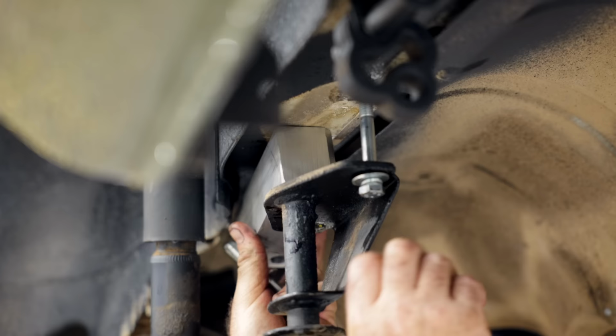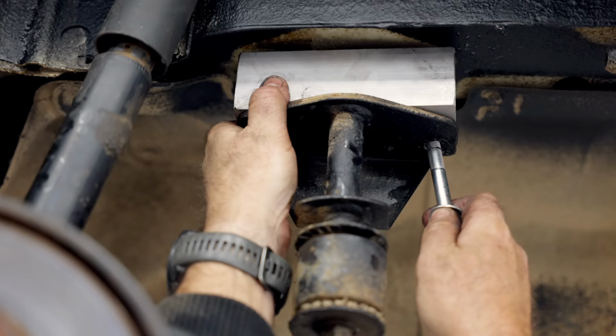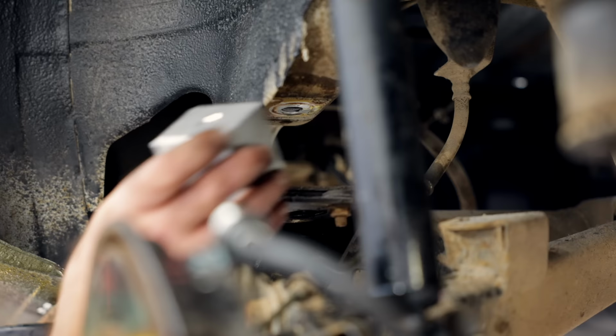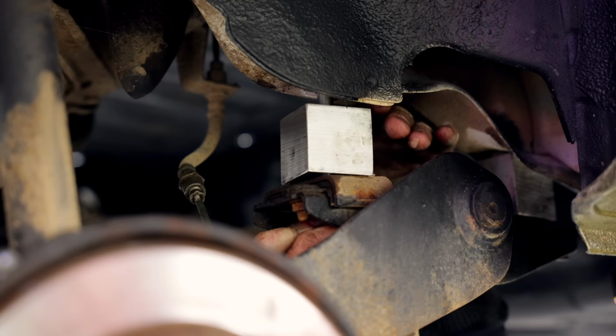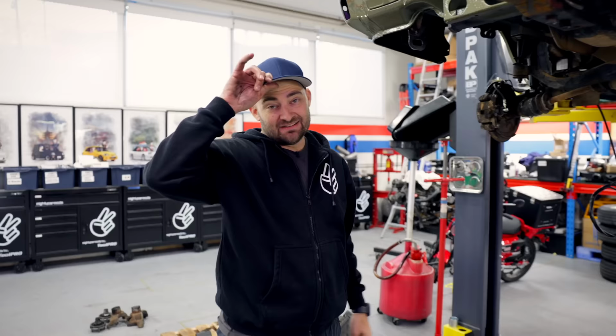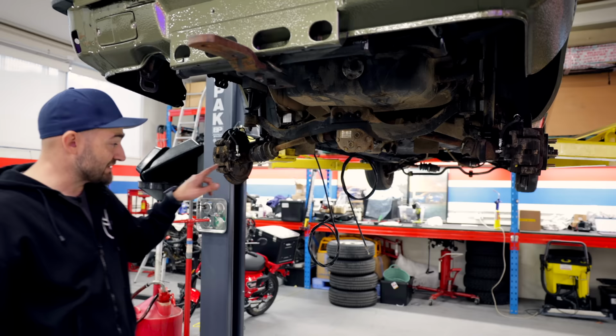This lift kit mirrors the way Subaru lifted the Outback version of their Liberty wagon, using one-piece blocks and extended bolts to suit. We then also need to extend or replace the rear shocks to make sure all the suspension works correctly. So thanks to Dave's expertise, the lift kit, which is freaking awesome, is in. And we now got a 2-inch lift in the back. So tomorrow morning, first thing, we're gonna do our 2-inch lift in the front.